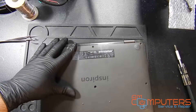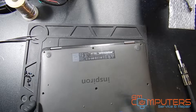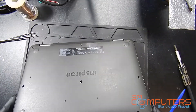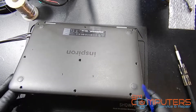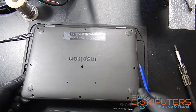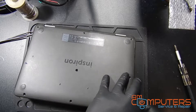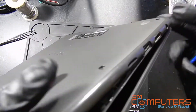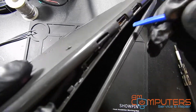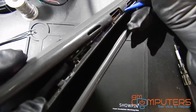As you'll see, as I get towards the top of the case on each side it gets a little bit more difficult. There's a little bit of resistance and I'm starting to think that maybe there's a screw or a tab that I just need to get under. I'm trying to get my spudger underneath there near the USB port, but think twice because there's no good leverage there.